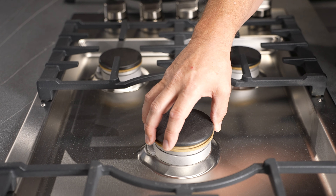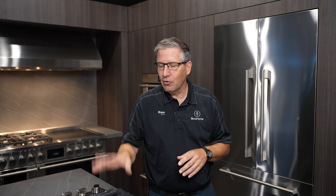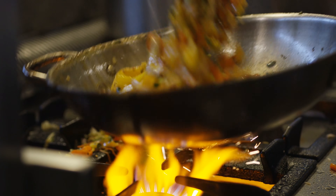Make sure that it lights properly — that is the biggest complaint I have with that. Basically it's boil-overs. Once I clean the burners, the caps, and the igniters, they're fine. These are the things you can check with your range to make sure it's igniting on the top before you call a servicer.